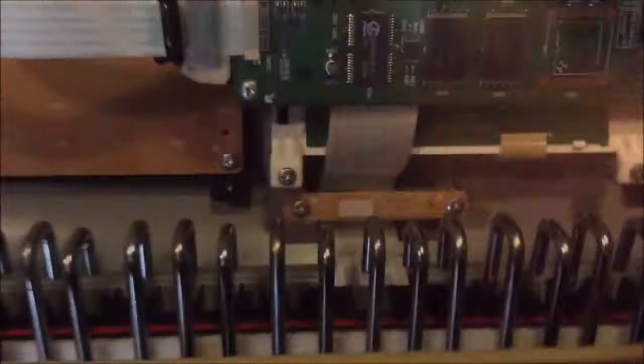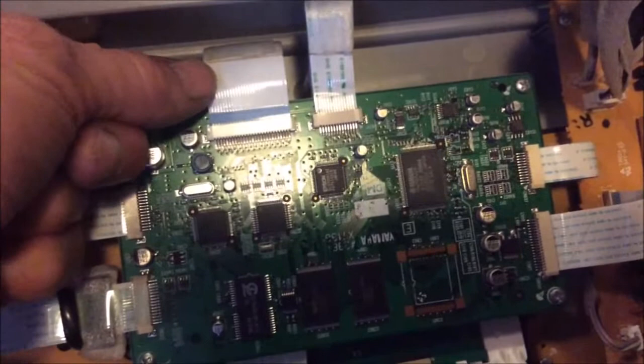Now all I have to do is take this keyboard and flip it upside down. I'm going to reroute the ribbon cable — it goes underneath here, through here, around, and into this little block properly. It comes underneath this little support and up through the center between the two circuit boards in the middle, then up and around. The shiny side is up and you can see the ribbon blue band at the end. When you insert it, use fingers on both sides to push it in — there's no clip, it just slides into place firmly.